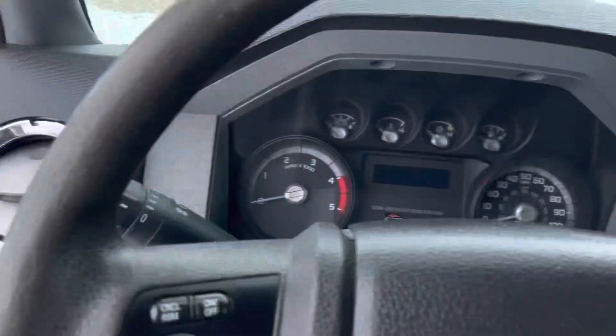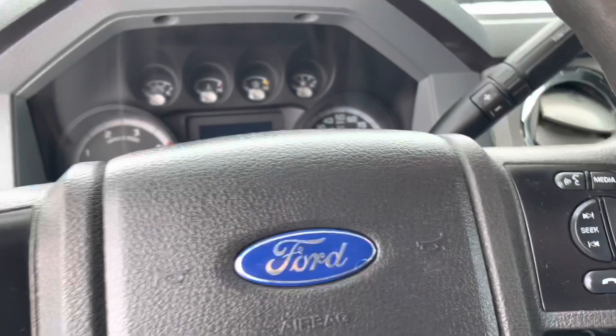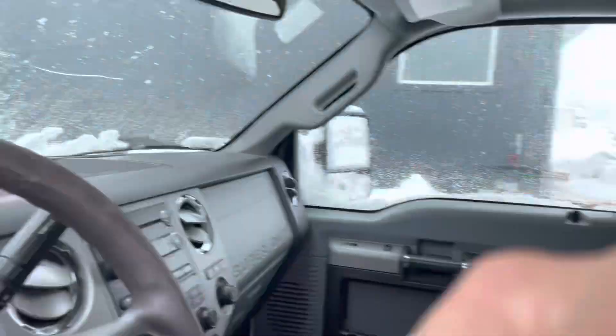No leaks, nothing dripping. This is what it was doing the other day when I came out to start it — my son had put the gas in where it said diesel. I came home, the lights were on, the door was ajar, and it had been a day or two so I thought the battery was dead and kept cranking it. Then I let it sit and idle for 40 minutes while I was working in the house, then drove it letting the battery charge, and I discovered partway down the road it was sputtering like crazy.